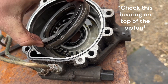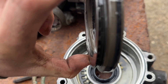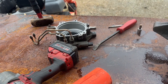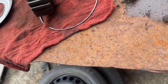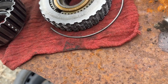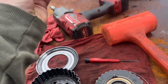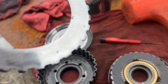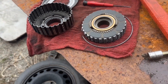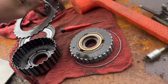This here is the culprit for grinding when putting your car into reverse or making sharp turns. You'll be low on all-wheel drive fluid because it's going back into the 75W90 gear oil. This is about a $56 part — you can get it from GM Parts Giant, I'll leave a link below. I highly recommend replacing it if you're going to go this deep into the job. Flip over the assembly and knock it gently against the table if needed — your friction discs and thin plates will fall out. Something to be mindful of: the thickest plate will sometimes get stuck all the way in the assembly. Here I noticed metal shavings on the inside, which definitely adds up with the fact that I was low on fluid and having terrible AWD grinding issues. I need to be more careful about service intervals and I definitely need to change my CL piston.